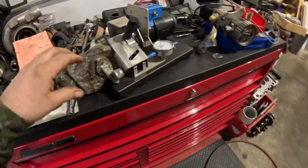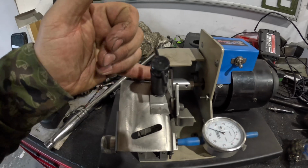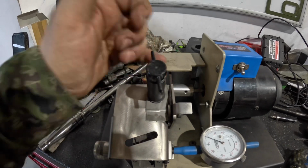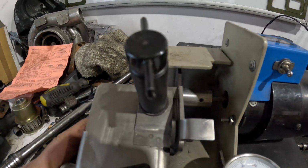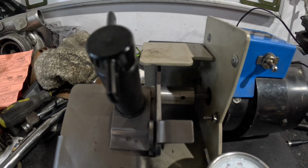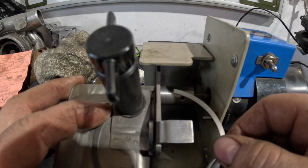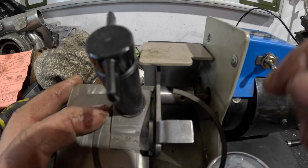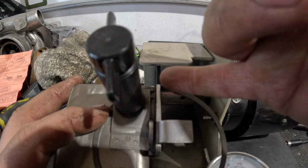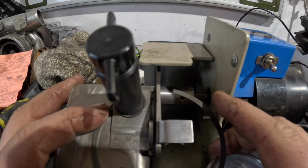So to do that I'm using this total seal ring file. We put the ring in this part here and then make sure it's running true with the stone by bringing this part down and then making sure there's no gap, which we can just adjust like that. But if the feeler gauge feels like it gets tighter as it goes further towards the bore, then we can just correct that by moving this ring on here slightly.